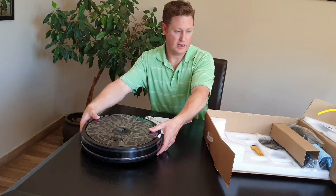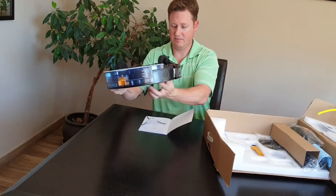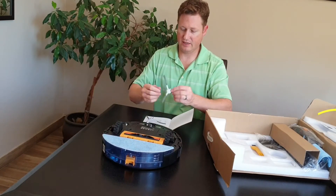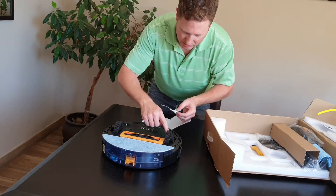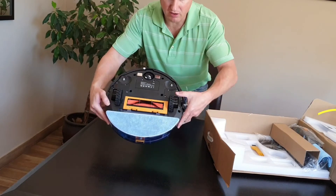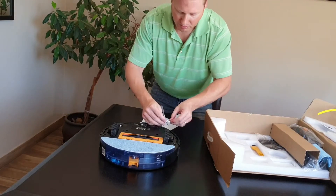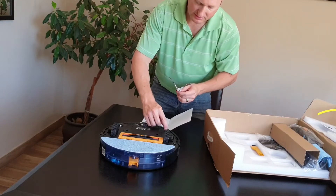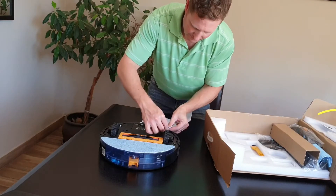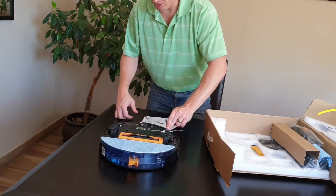What you're going to do — I normally suggest that you get a piece of towel or something, but I know that this table is very clean. So put it upside down there. You're going to take the right front sweeper. You're going to look over here — it actually says there's a big R. So you basically put the right sweeper on the R. You can see it's like a block type connection shape that you're going to basically place the front sweeper into.